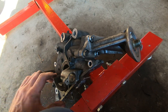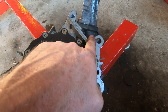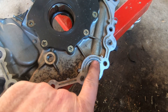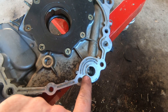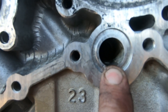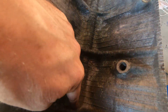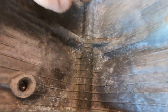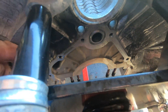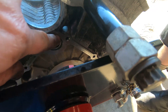Then that gallery there — we flip this over — just through here to this o-ring. There's an o-ring here; we're starting to see a few of them get hard, so I replace those in an engine prep. And it goes into the block right here, and that gallery runs right through the center of the block. We have another o-ring on the back of the block where the back cover bolts on, where the rear main seal sits into. So there's another o-ring there.